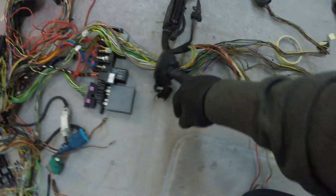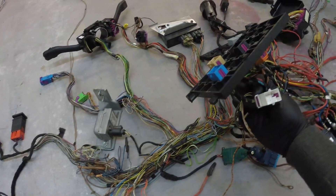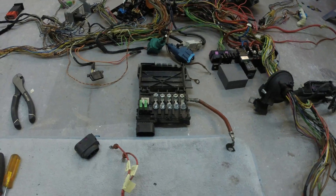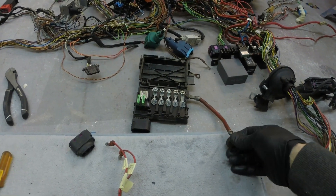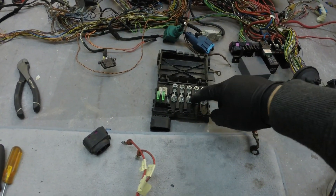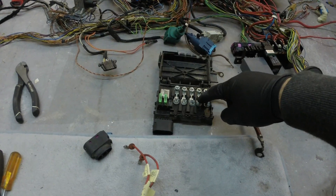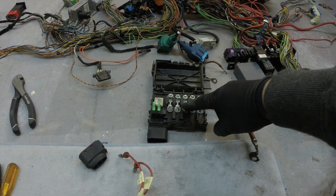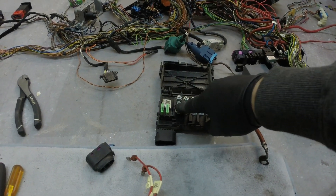And then we come through here - this is the firewall grommet. This is going to get removed and it'll have some bulkhead connectors to take care of this part of the loom out into the front of the body. These also go up through the rain tray and connect here for this part of the harness. This car had a small fuse block on top of the battery from the factory - it gets powered directly from the battery here, which powers this whole side of the block. This is where the alternator wired up, and this is where the power wire for the interior relay panel came from. This was for the fan module that was completely removed, this one was for the fuel pump, and this one the secondary air - which is deleted.